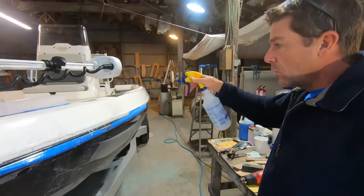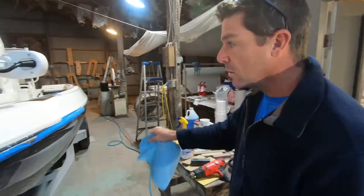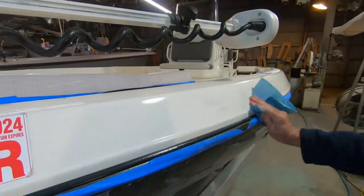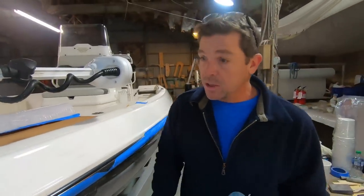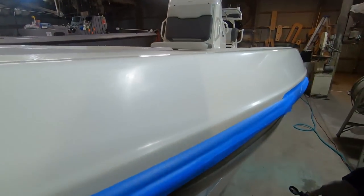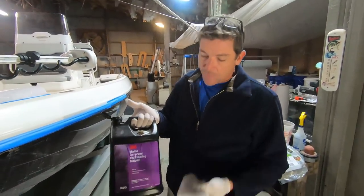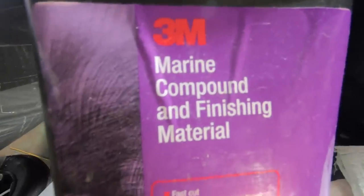We're running out of water and running out of daylight. You guys want to see what the final wet sand looks like. With the guide coat you can see there's a tiny bit of shadowing right there. That is pretty much it for the wet sanding — we finished with 2000 grit and blended it in. We've gone all the way from that little decal to about here. Since this is a fairly small repair job and I'm showing you how you can do it at home, we're just going to use a terrycloth towel and some 3M marine compound and finishing material.